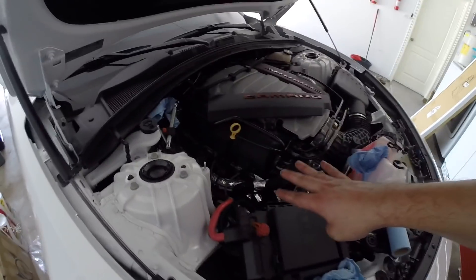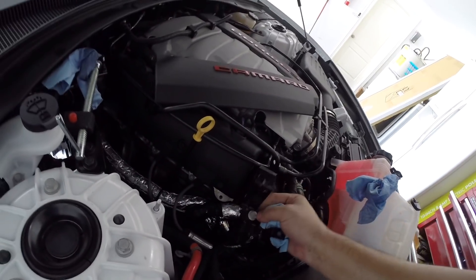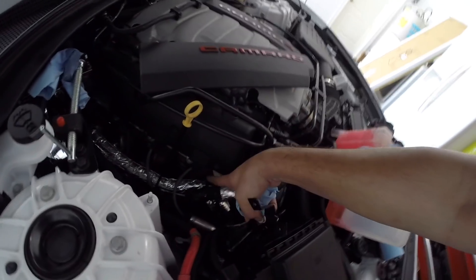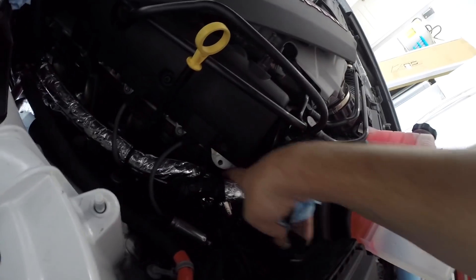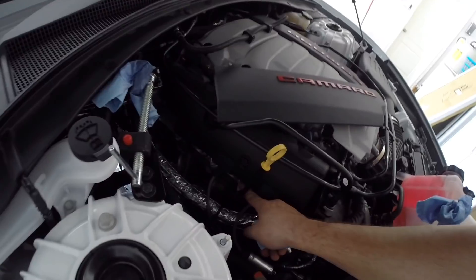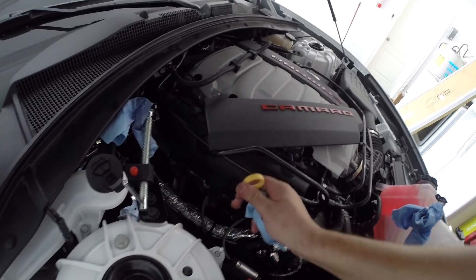I finally loosened up all the header bolts on this side and removed the two on the other side. I did have to remove this bracket — it's a 13-millimeter — which basically just holds these wire clips in. I removed them all and took that off to be able to get to the bolt right under it. I also removed the oil dipstick tube but haven't fully pulled it out since it's kind of stuck — I'm going to wait until I start moving the headers to really pull it out, because it definitely won't come out that way.